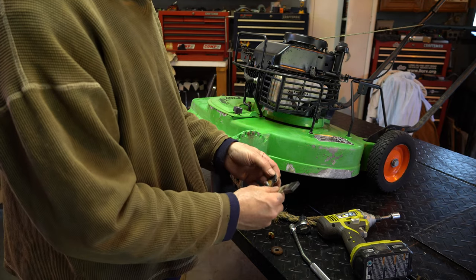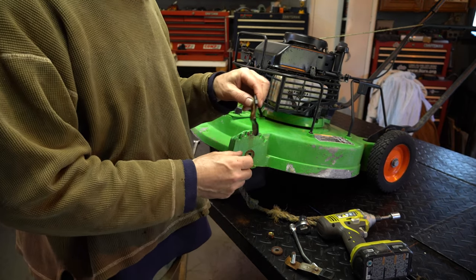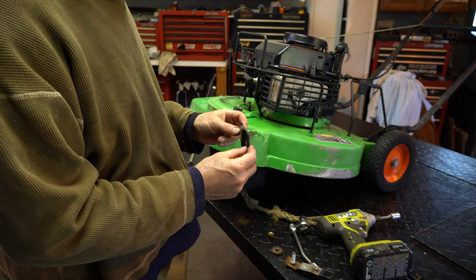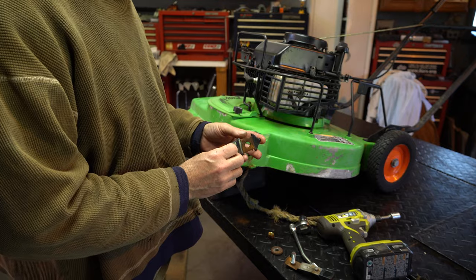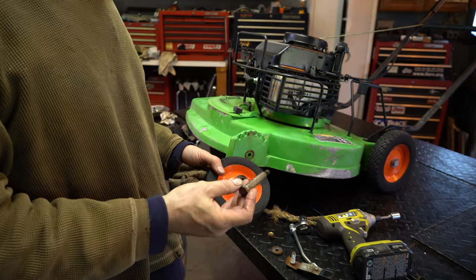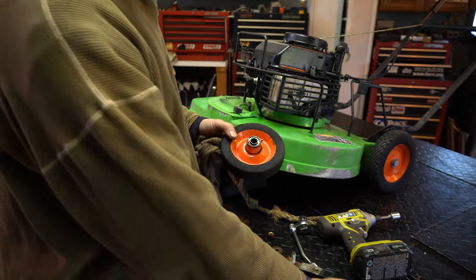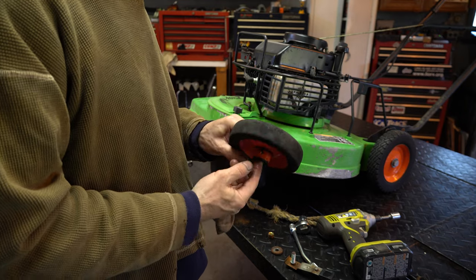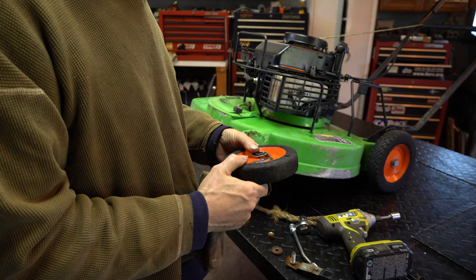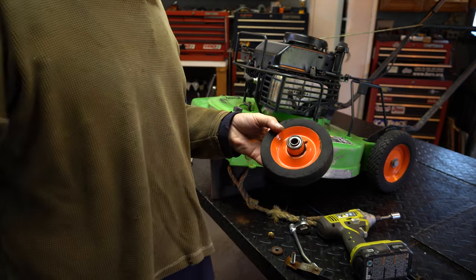It's not bad. It's in pretty good shape. So this guy is just a little bit bent. I'm just going to take it over to the vise and bend it straight, and we'll see. I drove this apart. It's kind of stuck on there. I'm going to run this on a wire wheel. I'll clean this out with a little solvent. Maybe run a brush through that because it's kind of naggy. Blow it out. I'll put some oil in. Blow it out. It's not too bad. And then we'll pump it full of grease when we're done.